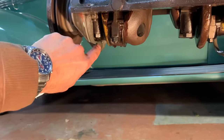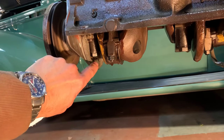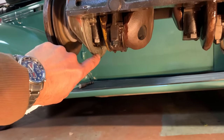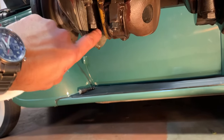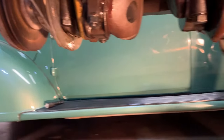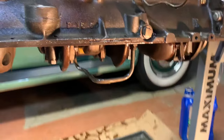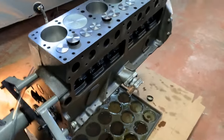I was kind of worried about maybe up at the front, that little oil pipe, little tube that comes from the front of the camshaft and oils the cam chain, timing chain. And I see oil dripping out of this area right up here. So that's dripping down from the timing chain and down out here. So I'm happy with that. Making good pressure, dumping the tank. I think it's on to the next steps.